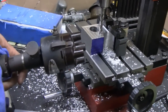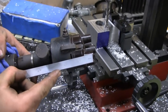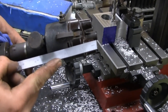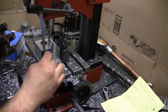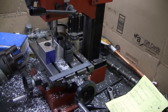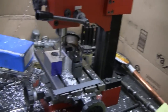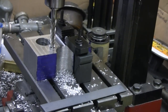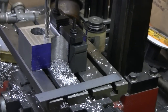Measuring to see how thick the block needs to be — just to get a rough idea of what it really needs. It's about one and three-eighths, which is fine. Right now I'm at about one and a half, so I've got to knock off a little bit. That's going to be a pinch block holding under the distributor. When it's done, I'll cut a slit in here and send a bolt through it so we can rotate the distributor for timing.